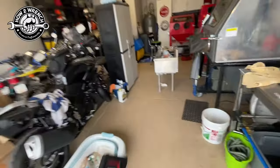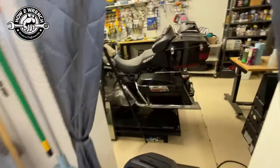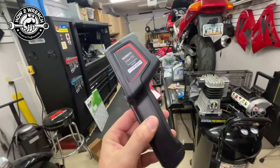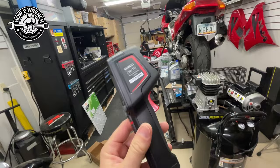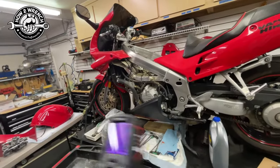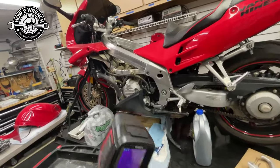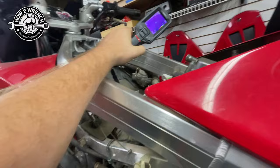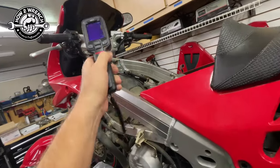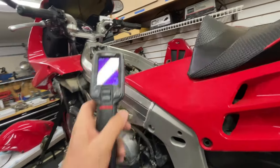Another way I've used traditional temp guns in the past for diagnosing motorcycles - I'll never forget where I found the biggest use of a temp gun ever. Back teaching at the college in 2007 on a GSXR 1000, we diagnosed an ignition problem that kept blowing fuses to a CDI over a heat issue in the harness. I got lucky leaning my hand on the harness and went 'oh my god, that's so hot.' We grabbed the temp gun and found that with the bike not running in a 70-degree room, as soon as you turned the key switch on there was a spot in the harness jumping to 140 degrees and then popping a fuse.